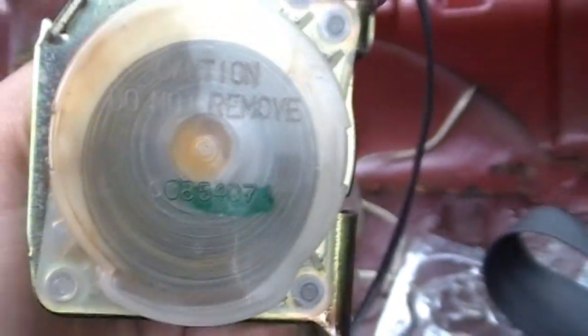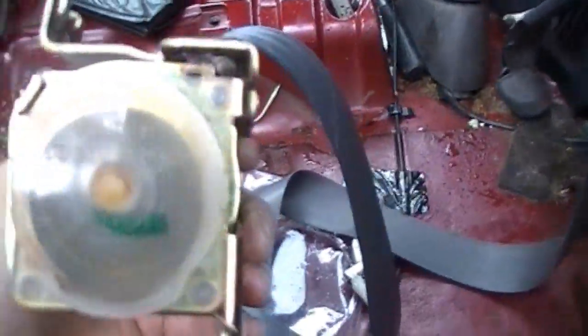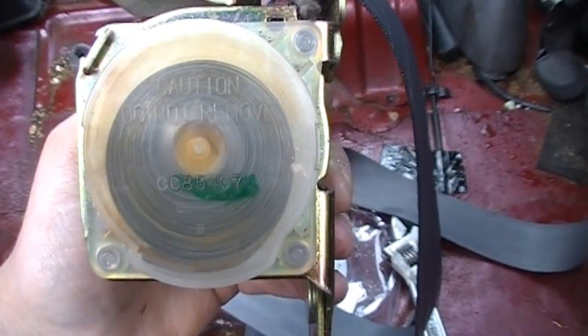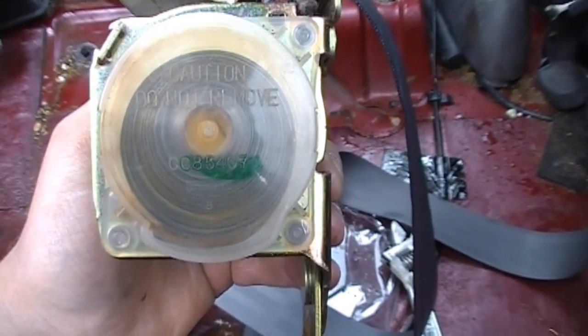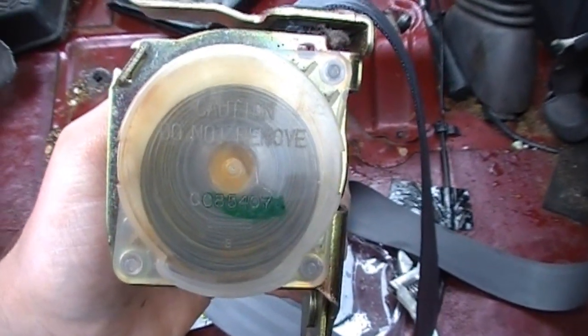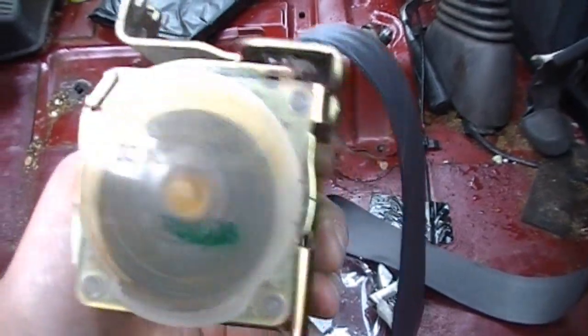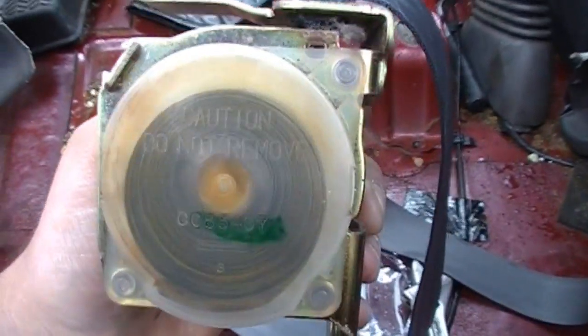What I can see here is, with the belt completely extracted, there's still a lot of wind left that I can do to wind it up. So that's what I'll be doing — tensioning it right up until I get the belt to completely retract again.